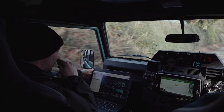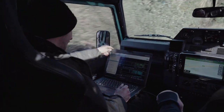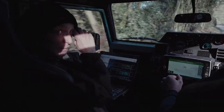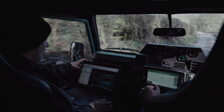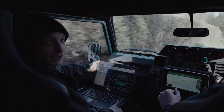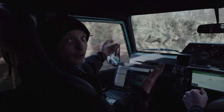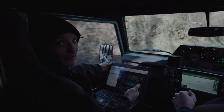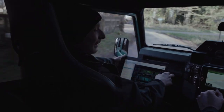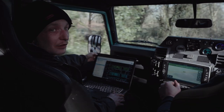So, for example, our coolant temperature is right now 90 degrees. So we've been stopped for maybe a minute, 2 minutes, and we've gone up 4 degrees. So that's very good. That means our cooling system's preventing the engine warming up even though there's no air running through it, which is exactly what we want. But then at the same time, we're listening for how hard the fans are working in order to keep it at that temperature without air going through it.